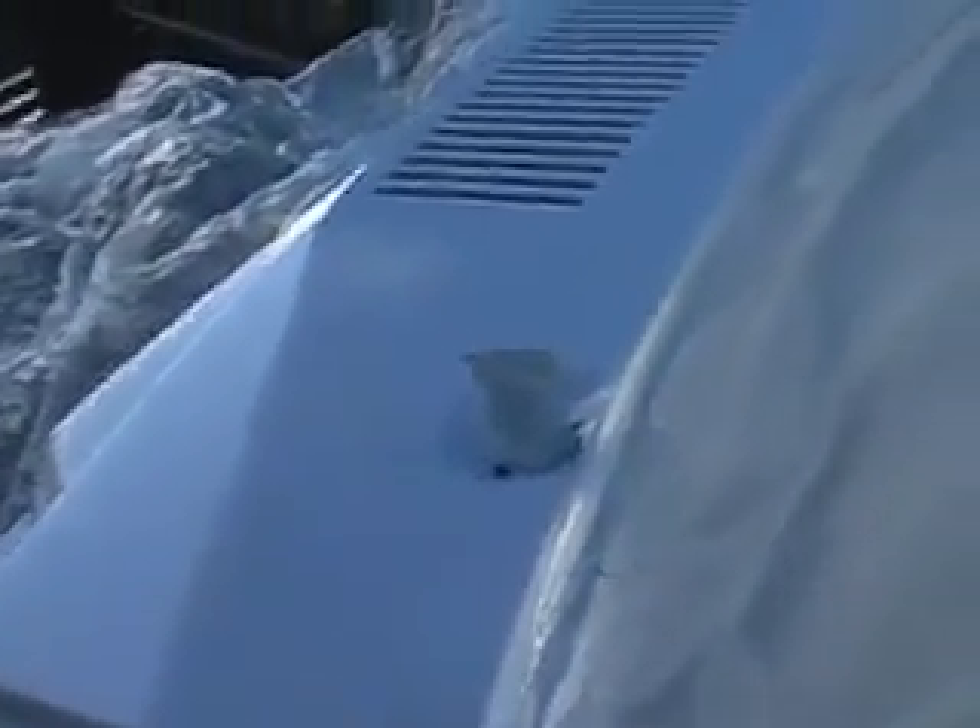Here's the double wet coat. It looks good — I got a little bit of dirt and stuff in it. I also shot this door real light. A lot of this was not sanded and I can still see the sand marks, so I want to get an idea what the paint will cover. It's doing pretty good. I can still see a little orange peel in that part but right in here on the front of the cowl it's as glossy as you're going to get. Looks really nice — maybe just a little bit of orange peel and a little dirt here and there, but not much more to be expected from painting out in the dirt.